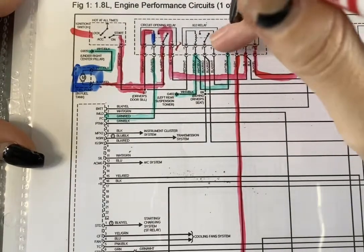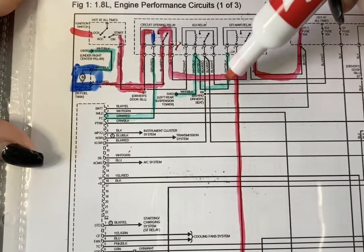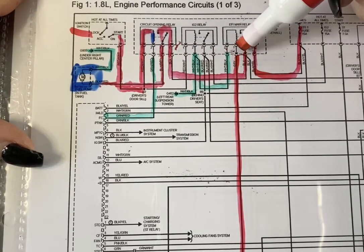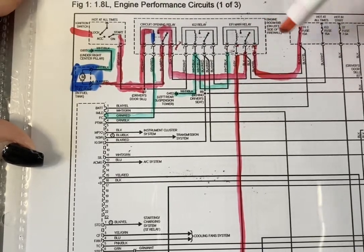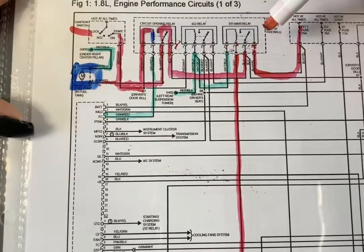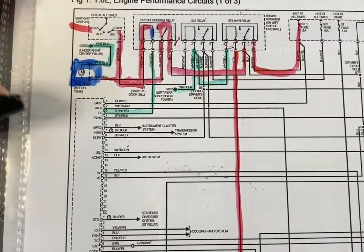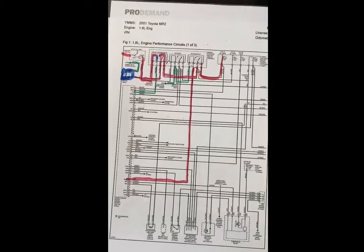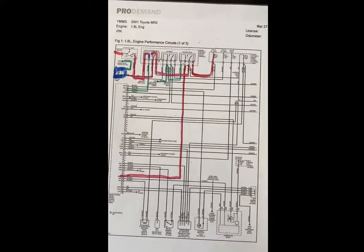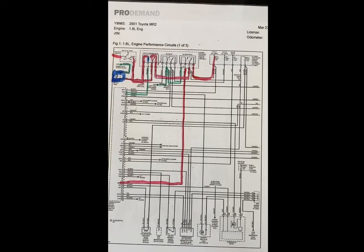If the fuse is good and I have no voltage coming out at three, either the switch is bad or the coil side is not being actuated. I'll check: do I have voltage going into the coil at number one? If I have voltage at number one, I should have no voltage coming out at number two. If I have voltage at two, there's an open circuit between there and ground. If I have voltage in but nothing coming out and the switch is still not working, the relay itself is bad — it doesn't matter which side failed. The same basic principles apply, and when you highlight just your relevant circuit, it goes from looking complicated to being a small, manageable chunk.